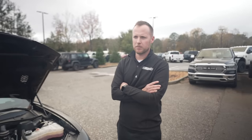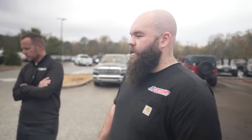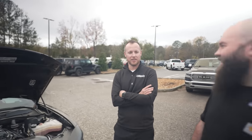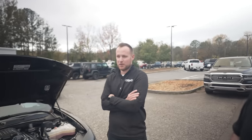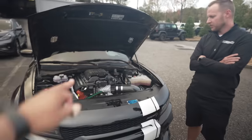Once you flip to the E-map on E85, you should pick up 80 to 100 wheel horsepower on top of your 93 number. So realistically on E85 on the Ghoul package, you should be mid 900s to the wheel on Tim Barth's dyno, maybe a little lower. On a Dynojet's old software, upper nines to mid nines. And to the crank, easily a thousand plus — the SRT page actually maxes out at 1,022, and that's where this car will be on E85.